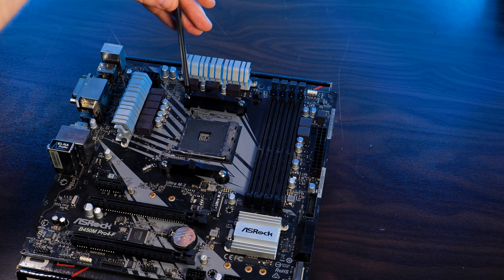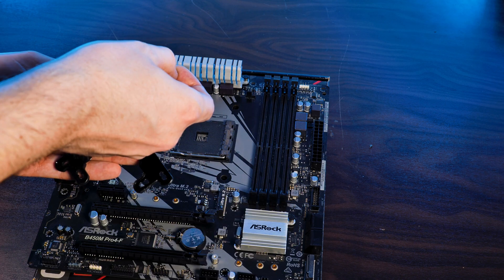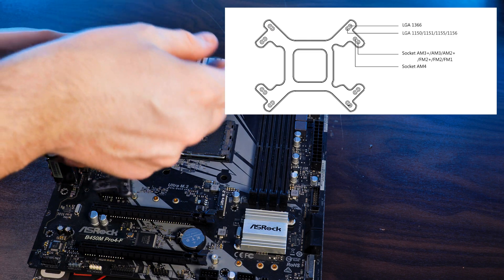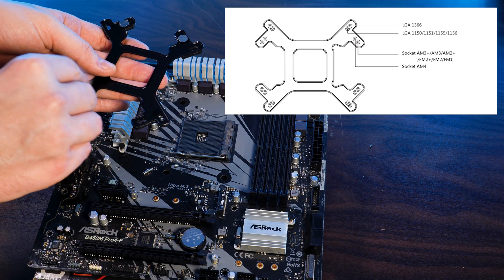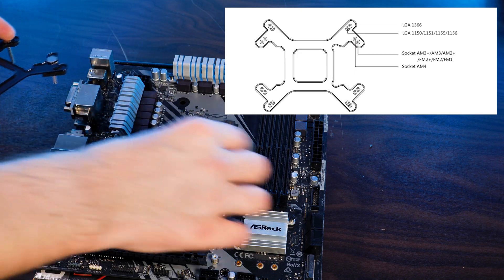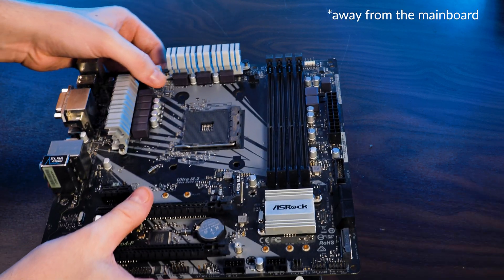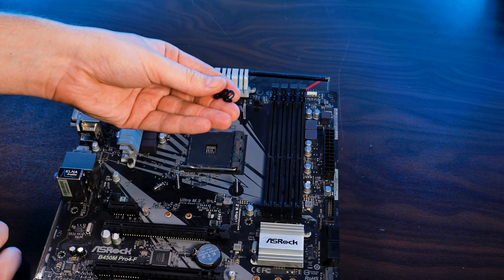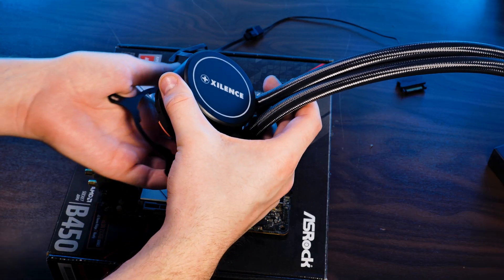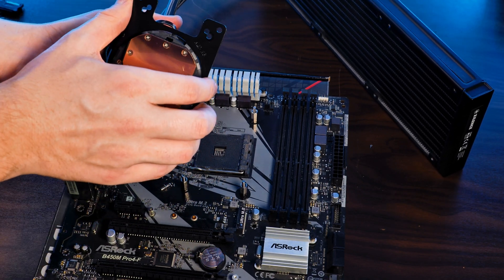Except for AMD users, who first need to remove the pre-installed brackets and backplate before continuing. From there, everybody needs to take the backplate and position the long screws in the holes according to your socket: the outer ones for LGA 1366, then LGA 1200 and the 1150 family, and in the central area the outer ones are for AM4 and the most inner ones for every other AMD socket. With the screws positioned inside the backplate with the edges facing up, place it behind the motherboard. In the front, put a washer on each screw followed by the nut. Then take the bracket that fits your socket — the round one for Intel and the longer one for AMD — and place it onto your water block from the base side and twist it to make it stick.